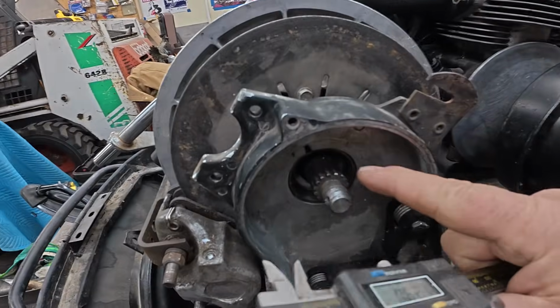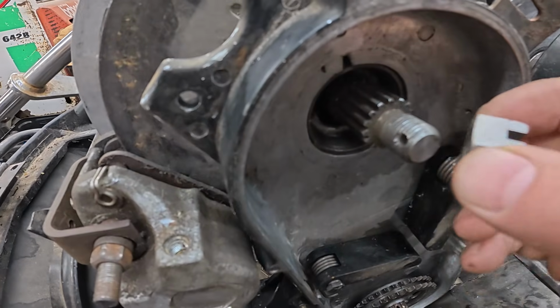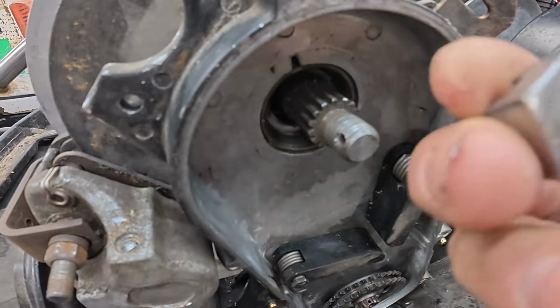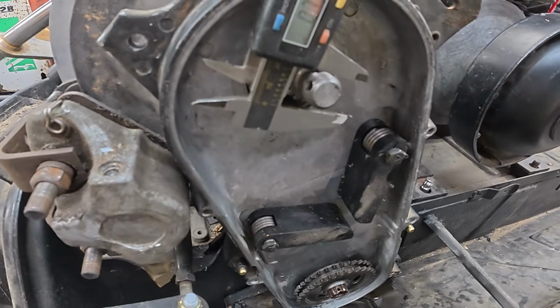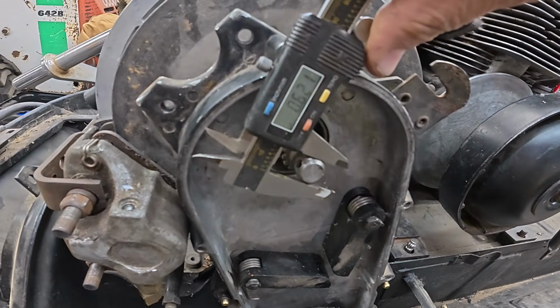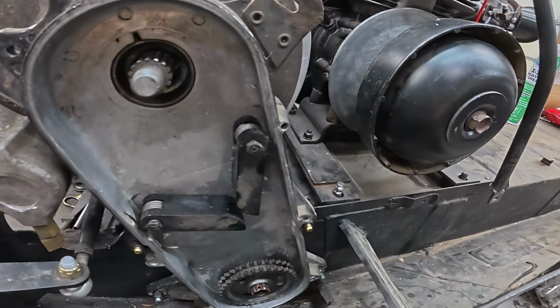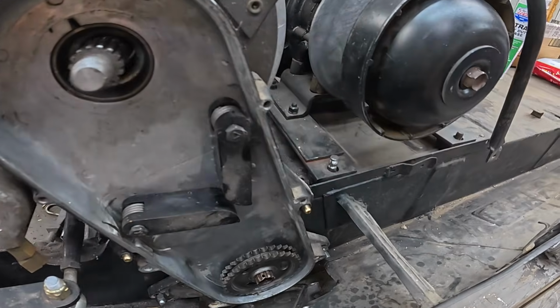All right, Greg wants to know how we're going to figure out what this top nut is here. And he brought one, but the thread pitch is obviously wrong. This is much finer thread. So, yeah, it's literally just caliper and C. And it looks pretty darn close to 5/8, but it's also pretty close to M16.